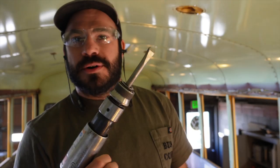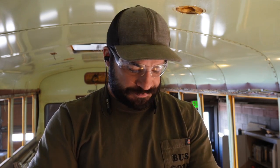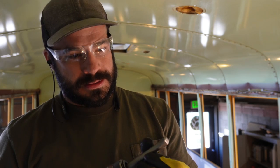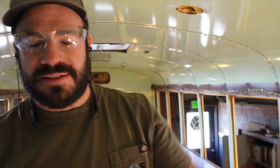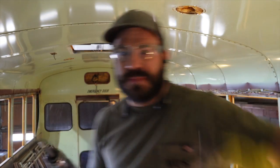That's my favorite tool. You can build most of the Thomas bus with screws instead of rivets. Occasionally there is the odd rivet or screw that does not want to cooperate, so I'm going to be using the air chisel to blast the heads off those and drop these panels.